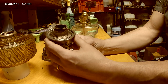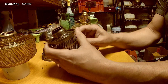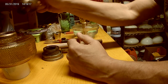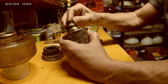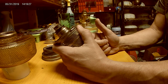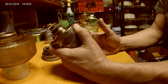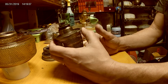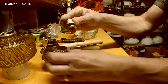At that point I would put in a brand-new wick and burn the wick. You put the wick in, advance it up so it's out, dip it into some kerosene, put the flame spreader back in, pull the wick down a little bit, and light it. Let it burn until it burns out - probably about five minutes. You usually have to do this outside because it produces quite a bit of black soot, but once it's charred you can use a wick cleaner to give it the right contour.